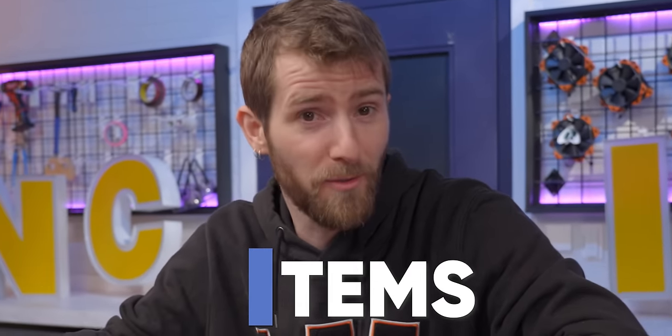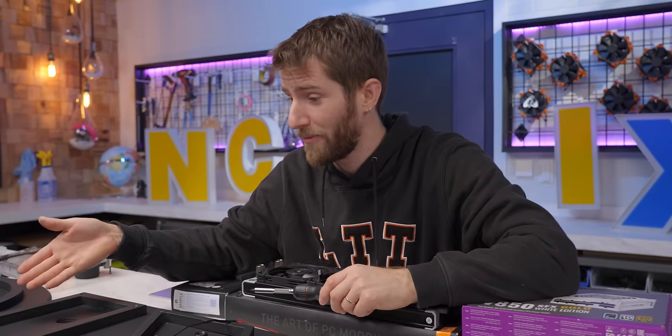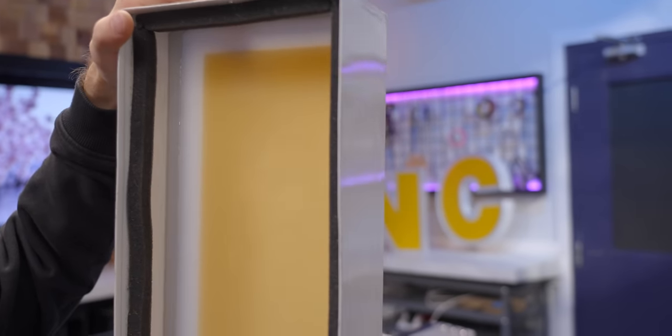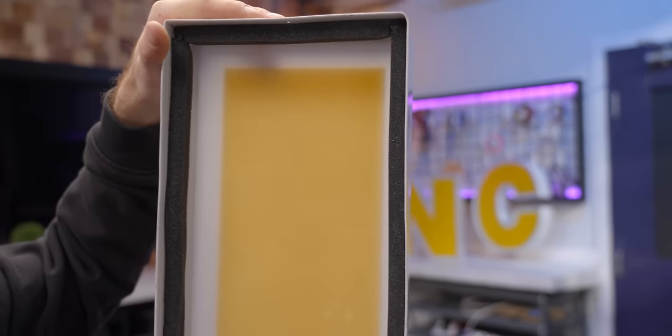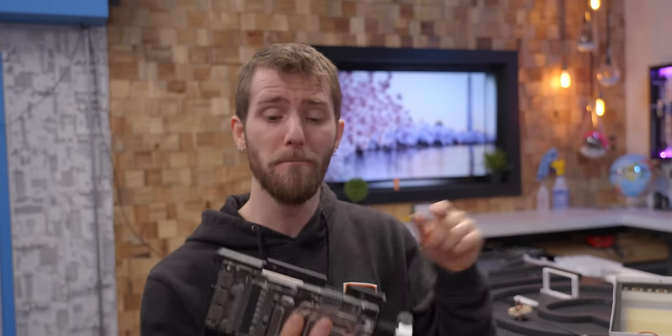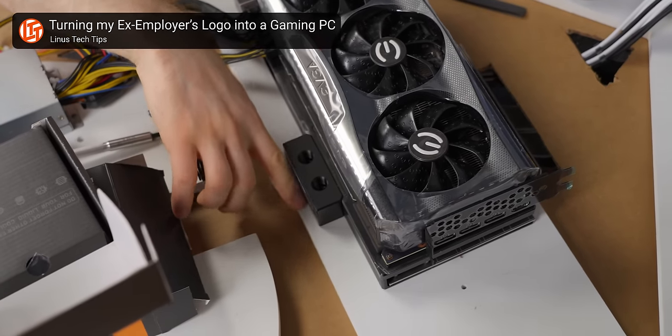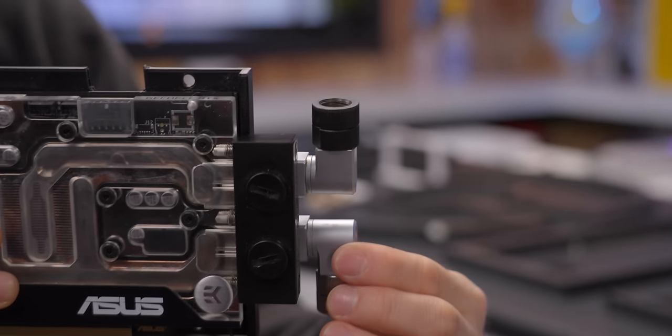The width of this letter was a big challenge when we went looking for a GPU. Even with water cooling, most modern cards are so tall that they won't fit in here once you account for the foam for the mounting — even before you factor in that most GPU water blocks have the fittings attaching up here. So we needed something where the fittings go on the back.